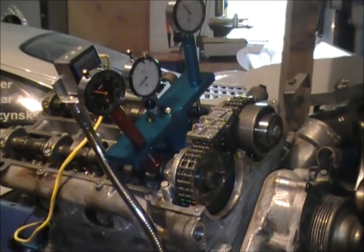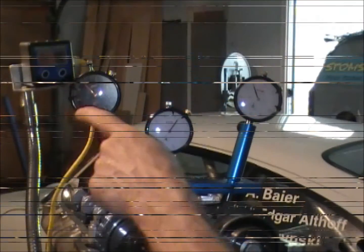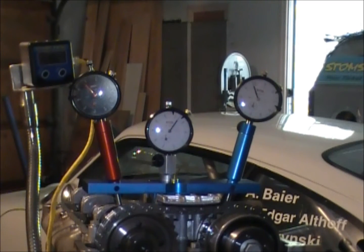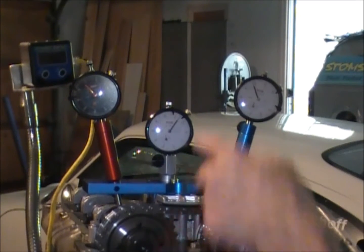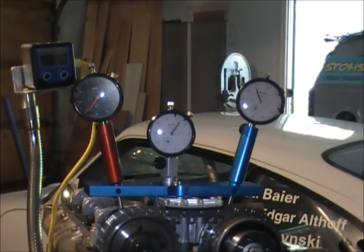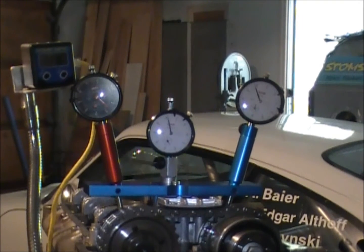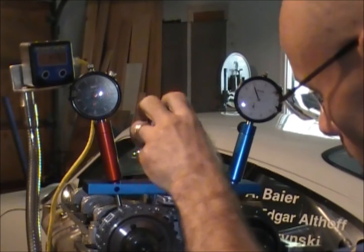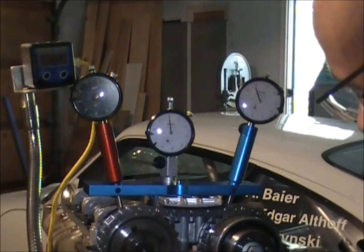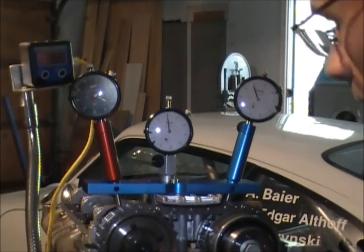The next step is we're going to tilt this up so it's heads up, and we're going to start to rotate the engine over and set top dead center. I've just turned our DigitX on so it's an irrelevant number because nothing's been synced up. I'm a few degrees out of top dead center as I had set up the cams and put all the apparatus in place. As I come up to top dead center, I'm going to be watching the center gauge and looking for the limit of the piston's travel. It looks like we're right about there now. I'm just going to put this to zero so we have a reference — and there's our dwell. That's what we're going to end up doing: splitting the dwell. I'm just going to back it up a little bit, and there we are at dwell again.